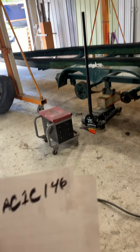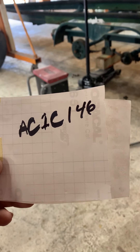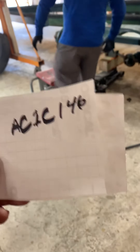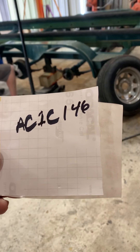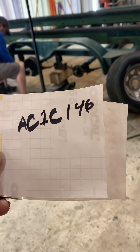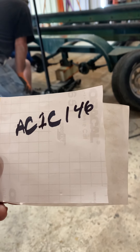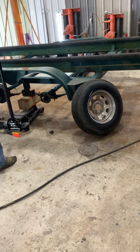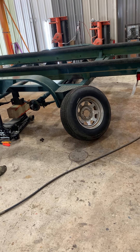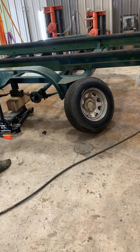So your tires — here's the code on your tires. One of them is 1346, the tire on the backside on this side is 1496. This code means the 14th week of 1996 is when your tires were made — they're 15 years old. While they don't exhibit any dry rot, I think most tire experts will tell you these guys are at the end of their life.